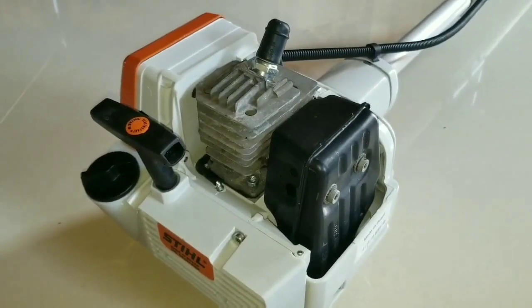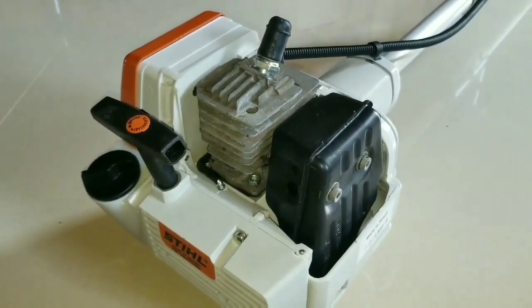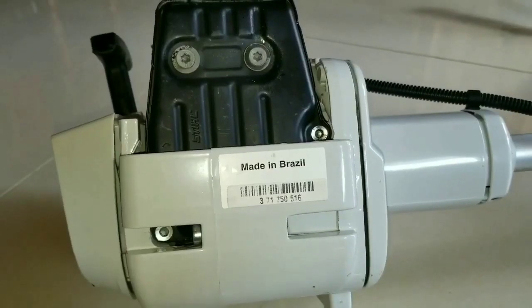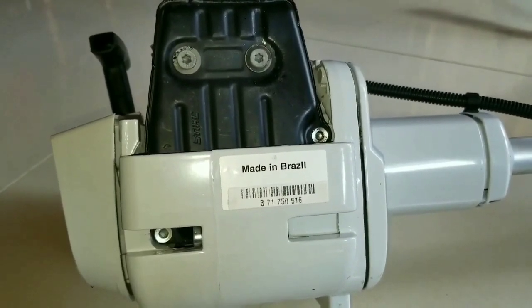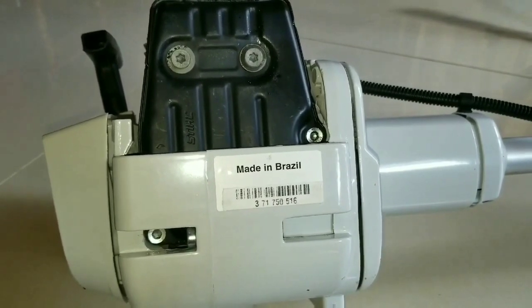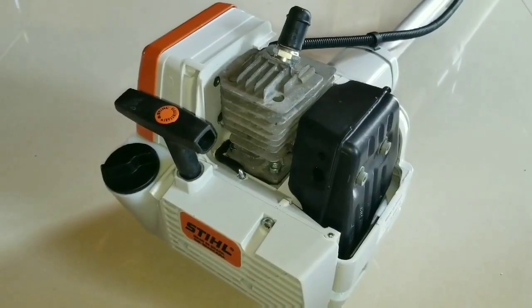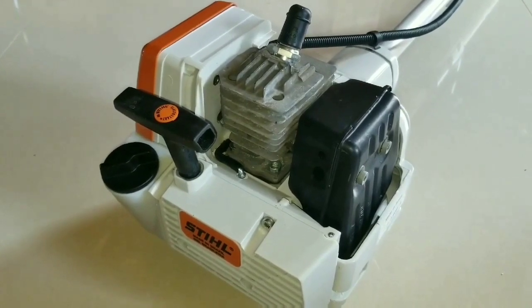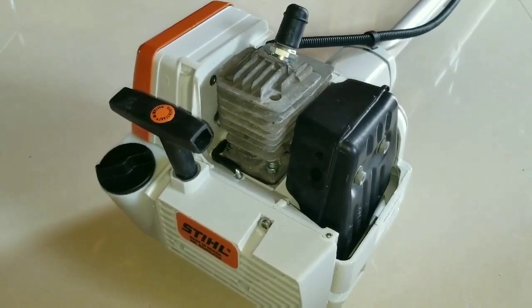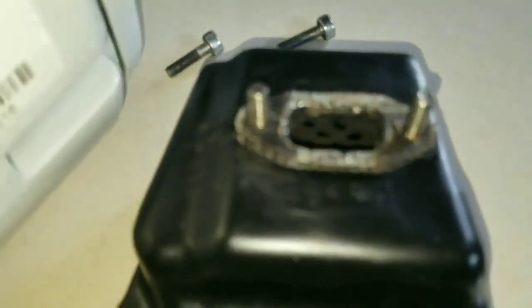In this video, we are going to be discussing the long-term disadvantage of the exhaust manifold muffler in relation to engine performance. On the side of the muffler, you're going to see 4 torx screws that are required for removing the muffler in the event it needs replacing or replacement of its gasket joint. Once the muffler has been removed from the engine, you are going to notice a baffle or spark arrestor inside of the muffler, and damage to its gasket like you see here.